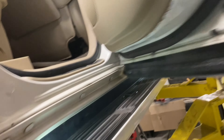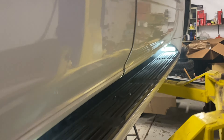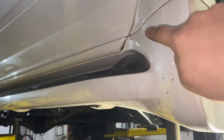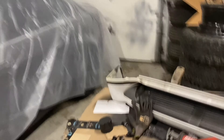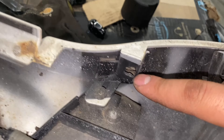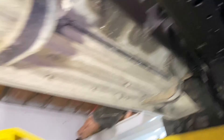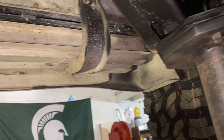I'm pretty sure Lexus has their own special tool to remove these. There are several in the back and several in the front. Underneath, we're going to remove two connectors. There's a connector right here and some pop rivets in there. For the hardware, you've got six 12-millimeter bolts that you need to remove. Let's go ahead and get to a time lapse.